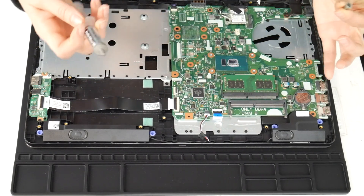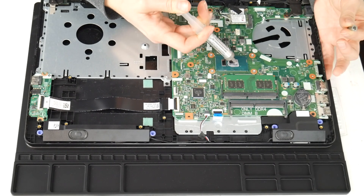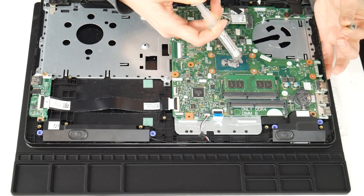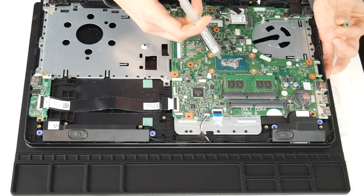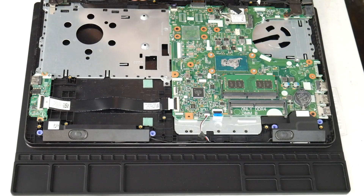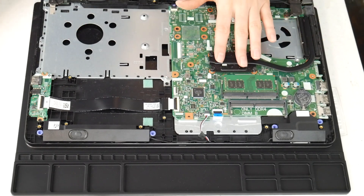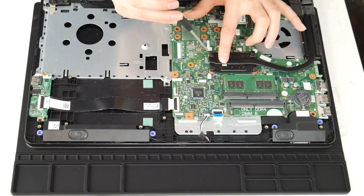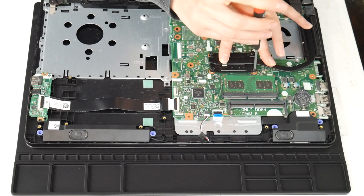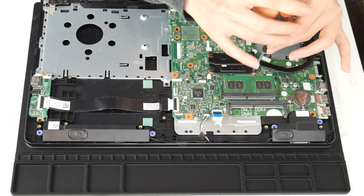The next thing I'm going to do is apply some thermal paste on the CPU. I forgot to clean off the CPU before doing this, but I do recommend that. As you can see it's dried out and there isn't much on there. I go ahead and put some new thermal paste — I've put a link below with some good quality thermal paste, because not all thermal paste is created equal. Then go ahead and put your heat sink back on. There are four screws, and it's kind of like putting a tire on — go one screw and then across to the other at an angle so you don't get one side tighter than the other.